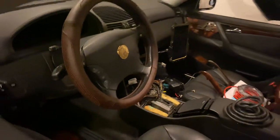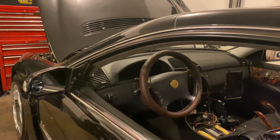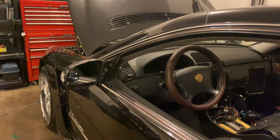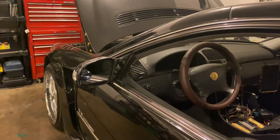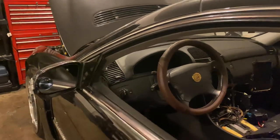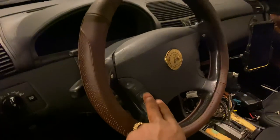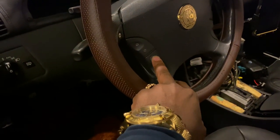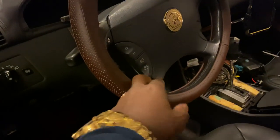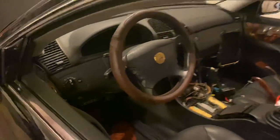On the SL, which I had pulled in the garage — you pull the ABC fuse on the driver's side. I can't remember what number it is, but you do the same thing. You pull that fuse, and I think that's the only fuse. Then when you start it up and the white light comes on, you hit the steering wheel control button that resets it — it allows you to scroll past the error code.